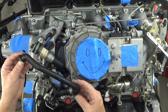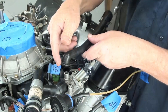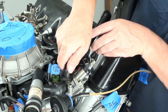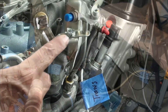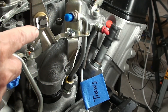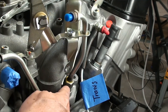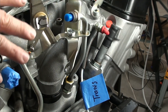Next is this thing which sits right on the side here — I put a little bit of petroleum jelly on there and put it over the top, make sure she's down. The last one I haven't talked about yet is the one that goes to the booster pipe — to the brake booster. Other than that, I think that addresses all of these.